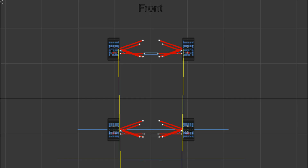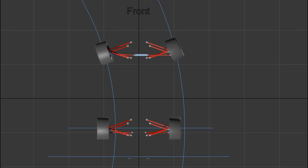In terms of steering knuckle angle for parallel steering, the yellow imaginary lines passing through your steering axis and ball joint should be pointing straight backwards rather than inwards. That previous example assumed a really sharp corner with small blue circles. Now imagine a car going around a really long sweeping high-speed corner where the blue circles are very large. Applying the same slip angles to this example, you'll see that you're actually turning your front outside tire more than your front inside tire to meet your proper slip angles — the exact opposite of what normal Ackerman geometry suggests. That's why this geometry is called anti-Ackerman.